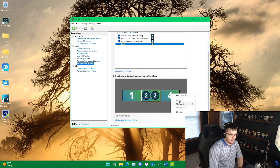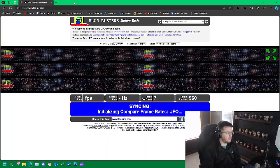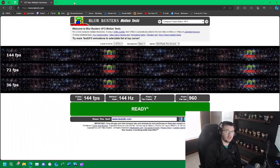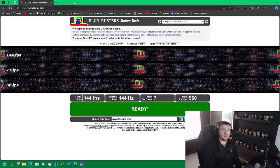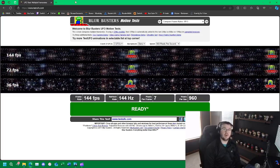To do that, you just right-click and select Clone With, and then clone. To prove we're actually getting the full 144Hz, I've got the UFO test here. We'll refresh the page. We can see the frame rate at 144fps and the refresh rate at 144Hz. So if you have a 240Hz or 175Hz monitor, this setup will work for you and you'll be able to use the full capabilities of your monitor.